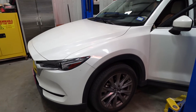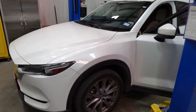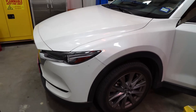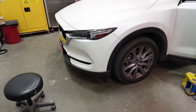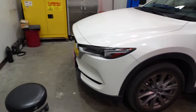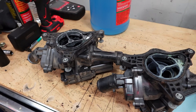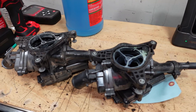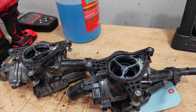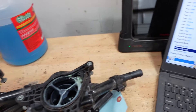I already went ahead and scanned the vehicle and got the code P0126. Whenever I get that code it's always been a coolant control valve — I've replaced quite a few. These are two right here that I replaced this past week. They'll start acting up whenever it's cold outside; it's winter time right now, about 30 degrees outside.